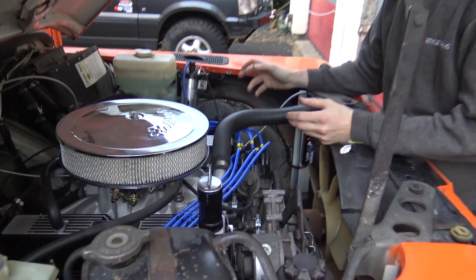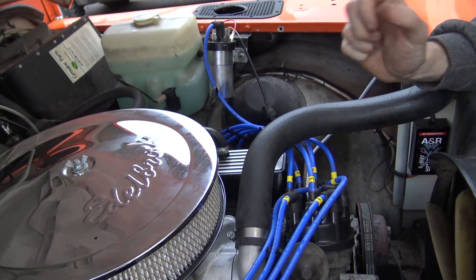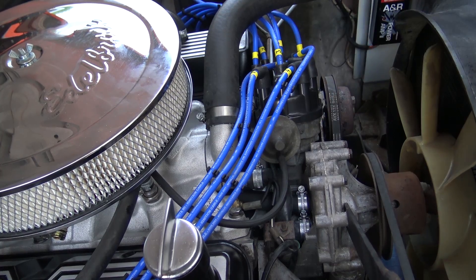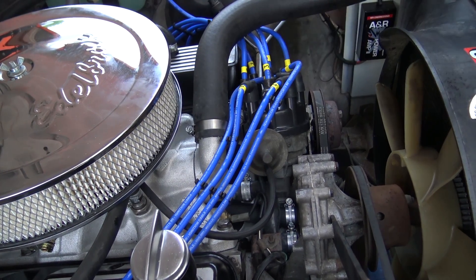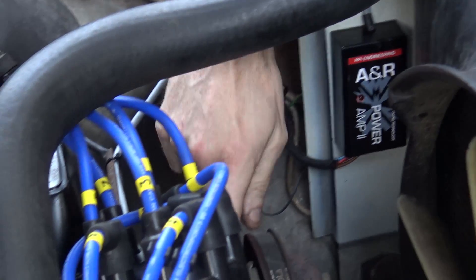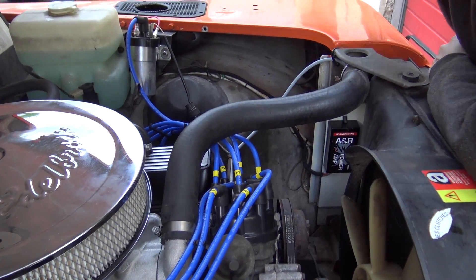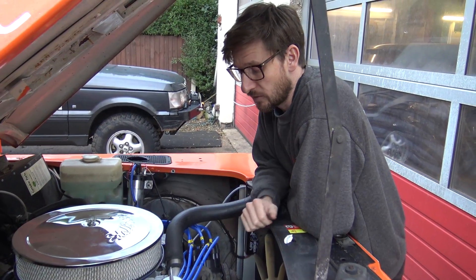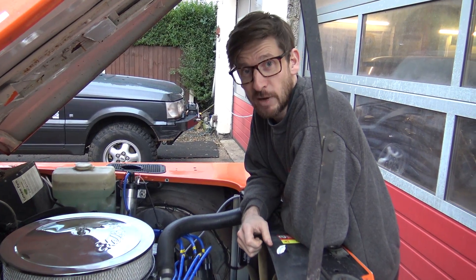Holly has fitted the ignition kit and done a full tune-up. Ignition timing is set and emissions are set on the carburettor as well. Just a brief overview of the ignition kit: the vacuum advance checked out okay - we suck on the pipe and make sure the diaphragm pulls the base plate. The mechanical advance was good inside the distributor as well - the rotor arm snapped back sharply and there was minimal free play. The RPI amplifier is mounted on the wing with its cable plugged into the side of the distributor, and the wires run up to coil positive and coil negative, with an earth on the clamping plate. Magnacore plug leads are installed and we've done a compression test while the plugs were out - everything is perfect on compressions. We fitted non-resisted spark plugs.